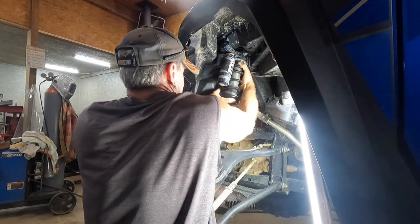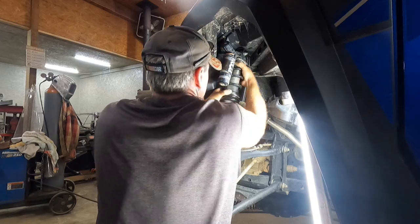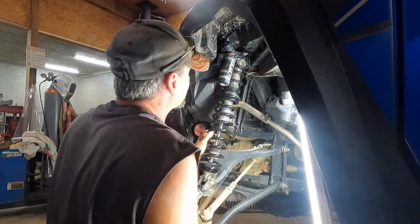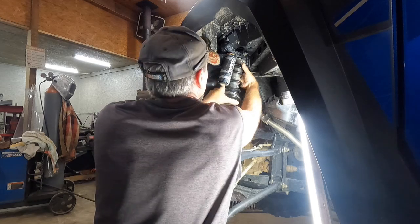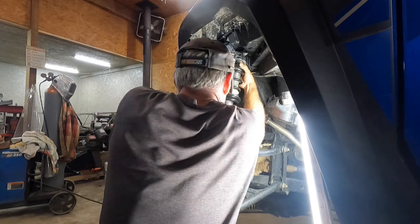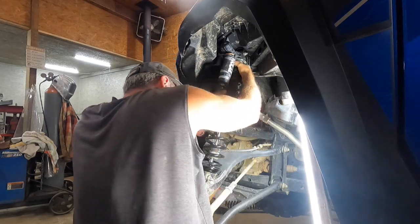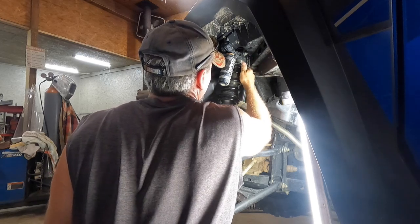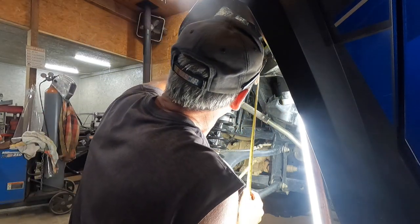It was 7/16 on the tape measure. I figured that was close enough because I wanted to cycle everything. I figured it'd probably be some sag anyhow, so I figure I'll cycle everything before I worry about getting it exactly where I want it to be. Besides, I may need to crank it on down some more to get the right height back up to where factory should be, or more. I may have to find my spanner nut wrenches.